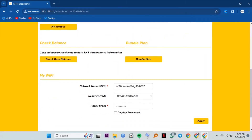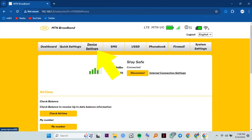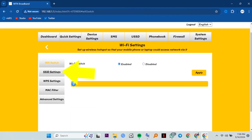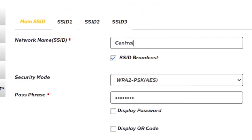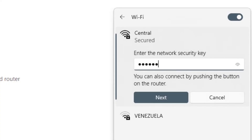When we scroll down, we can change the Wi-Fi name and password right there very easily. But I usually prefer the other way which gives more options — though the quick method can work too. Tap Device Settings, then you'll get a page showing devices connected to the Wi-Fi and those connected via cable. Tap Wi-Fi Settings, then SSID Settings. At the network name, you can change to whatever Wi-Fi name you want. The passphrase is where you set your password. Max station lets you set the maximum number of users connected to the Wi-Fi. When done, tap Apply, then Yes. Now you can connect with the new password.